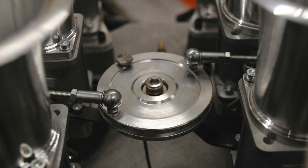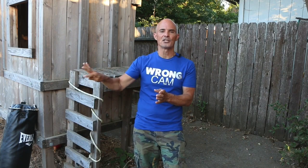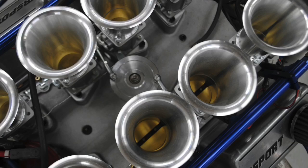The final thing to consider is drivability. When we run it on the dyno, we go to wide open throttle — it's easy to get all the blades synced, there's enough airflow, they make a ton of power. That's never the problem. The problem is at the other end of the spectrum: at idle. And it's usually not a tune problem — it's actually a mechanical problem. You have to get all the blades synced up.